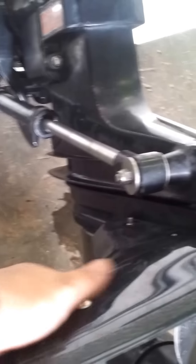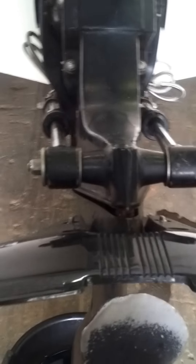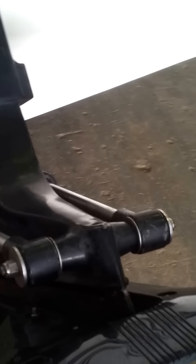There is a hex head bolt that you'll need to get access through this hole here, and it threads into this little trim adjustment piece — forgive me, I'm sure somebody will correct me — where it goes right up into there and that hex head threads into it. There's a little extra if you're familiar with pre-alpha outdrives: this thing here is a little tail fin or whatever that was added on. Shortly after we got the boat it helped us pull in skiers, so this is added — you won't see that on every pre-alpha, but it's just exterior mounted. Nothing special about that, that's why it looks a little different in case you're wondering.